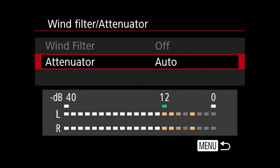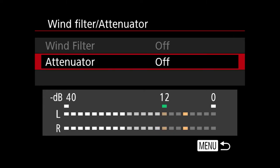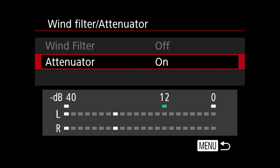Press set to confirm. For the wind filter and attenuator — we really don't need this, but if you're a professional and want full control over audio, leave it off. If you want it on all the time, press on. As you can see, it squashes my sound — this is overkill in most situations. I usually leave it on auto because if you're outside and the wind picks up, or recording something really loud, it'll attenuate the signal enough so it doesn't clip, crackle, or pop. It's a really good safety net.